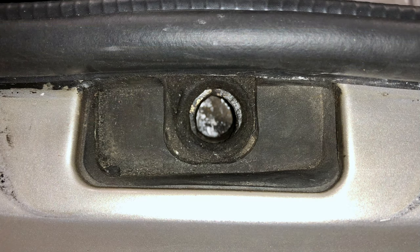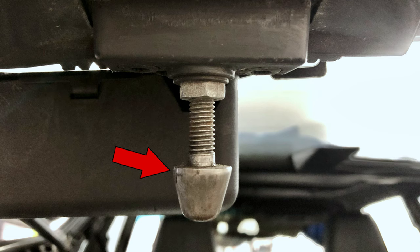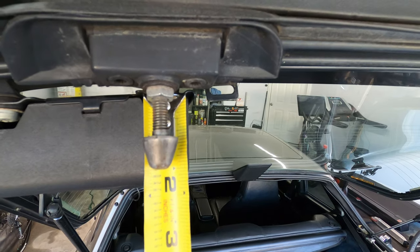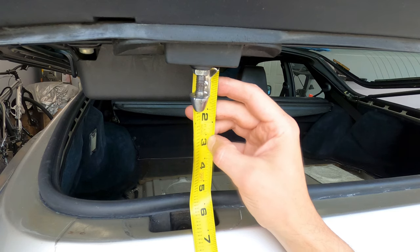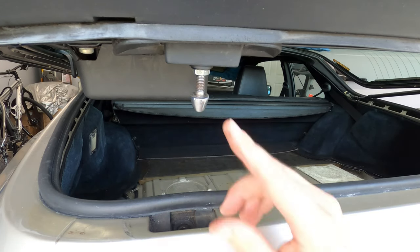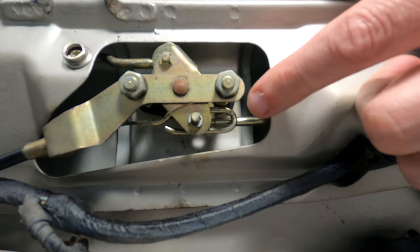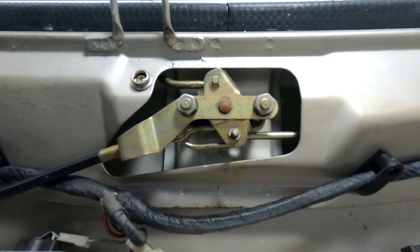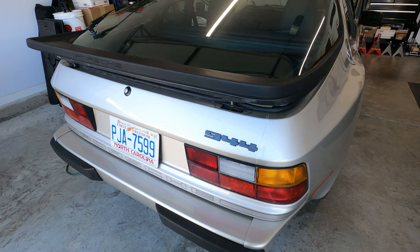When I inspected the components on this car, I found that the locking arms within each pin receiver were fully closed and the rods properly connected, so no adjustment was needed there. In looking at the hatch pins, I found a small amount of wear on the left pin and after measuring the pin heights, the left pin was extending out about 1/16th inch further than the right pin with a little bit of gap on the left side. So I went ahead and tightened the left pin to match the height of the right pin, which also allowed me to move that wear point to a section that doesn't directly contact the locking arms, and that way I'll get a little bit more use out of these pins. I also discovered some play at the end of the motor cable system that was causing the lock to open only halfway when released. After adjusting the pin, eliminating the cable slack, and retesting the automatic release, the hatch is now opening properly.